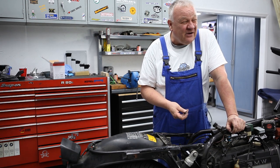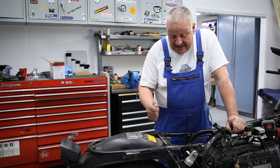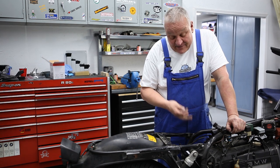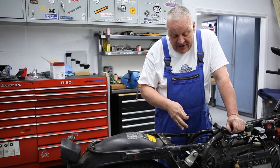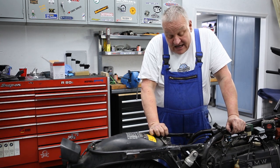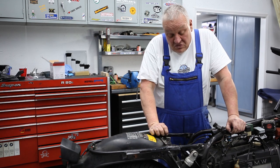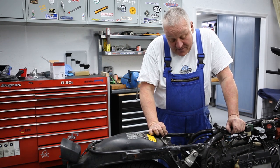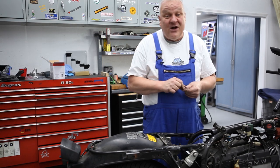I've had that bike over there for about 10 years now and I go back about once a year to ride. My ritual when I leave is: I take the battery out of the bike, store the bike at my buddy's house, and then I put the battery on a charger with an Optimate battery charger and just leave it on there. I've had the battery now for seven years and it still works great — if I need to replace it I would always get this battery.